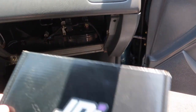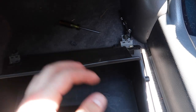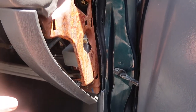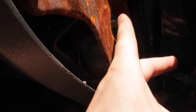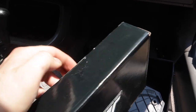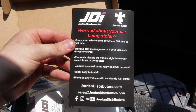Did a lot of off-camera work for the JDI kill switch. All you need is an 8mm for these two bolts — pop those out, then a Phillips head to pop out the screw on the side panel right here. Then use a plastic pry bar for trim panels to pop everything out so it exposes the bolt to the main relay, which the kill switch is going to be replacing and hooking up to. Kept everything pretty much together for the unboxing.